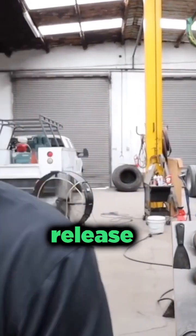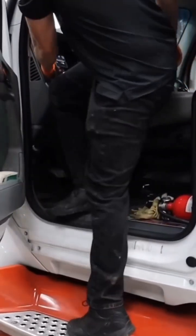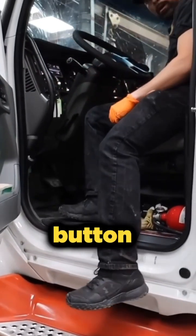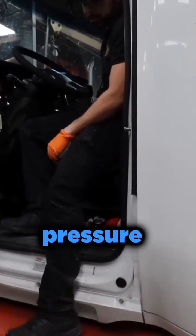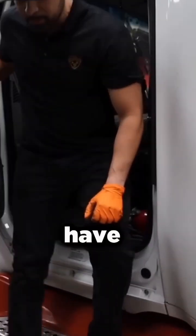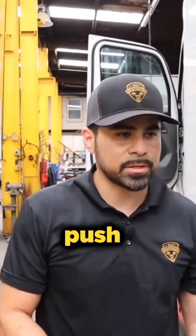What I'm gonna do now is go ahead and release these brakes. I'm gonna hit the yellow button on the truck here to release the brakes. You've got to make sure you have 100 pounds of pressure in the system. If it doesn't have 100 pounds of pressure in the system, then you need to go ahead and crank the truck up, make sure you have 100 pounds of pressure, then push the button in.